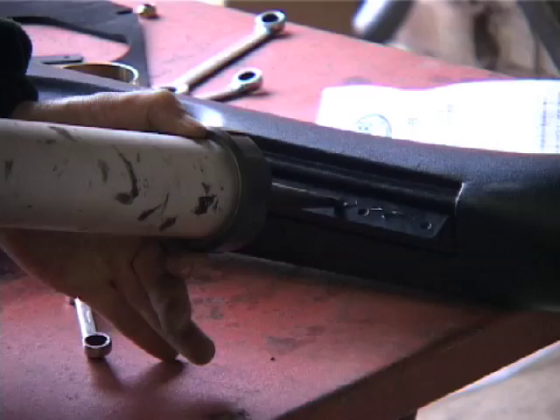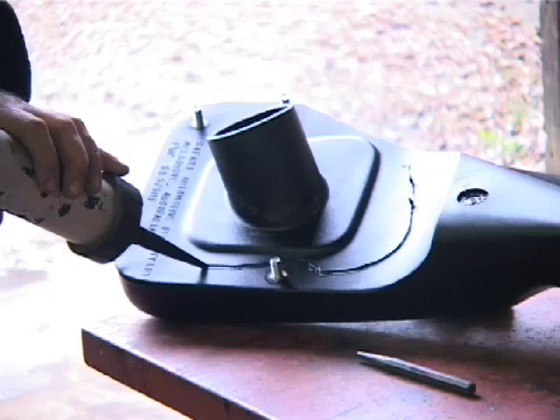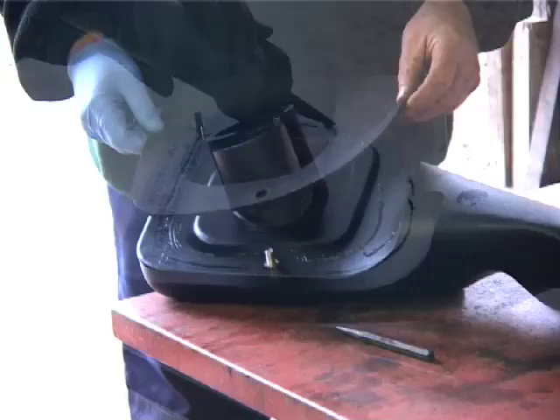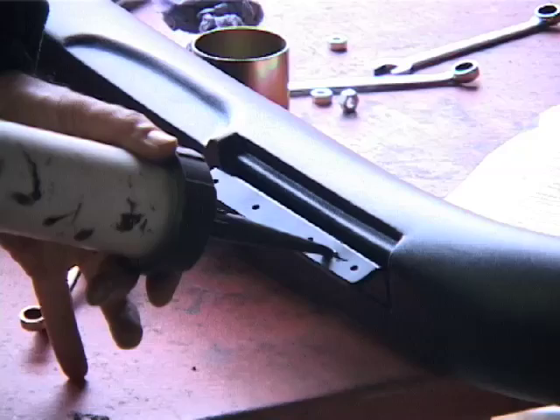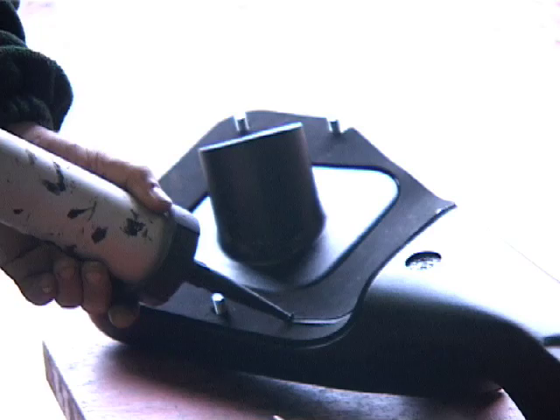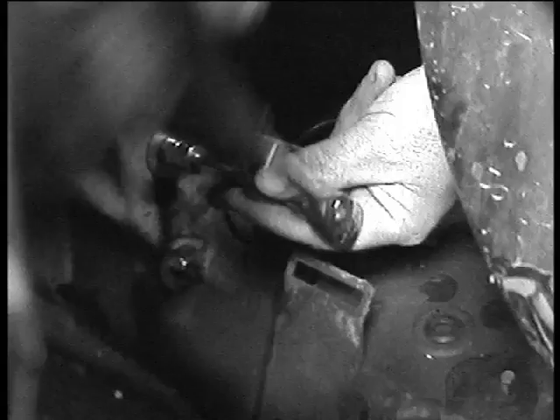Once everything's been positioned it's ready to be siliconed. We use silicone to fix the foam gaskets onto the snorkel - this prevents movement and adds an additional seal. We apply it on the window bracket mount and also the lower area of the snorkel where it mounts onto the wing, then push the foam gasket over the top and press it firmly so the silicone spreads and sticks down nicely. Once the silicone is on, we mount it onto the vehicle finally using the nylon nuts to tighten it down firmly and securely.